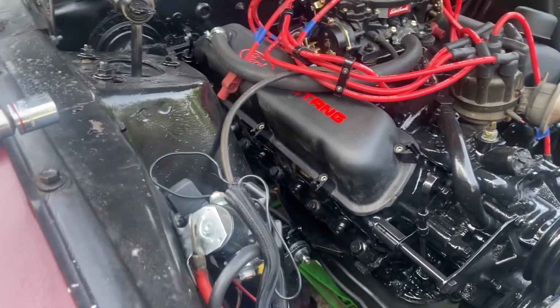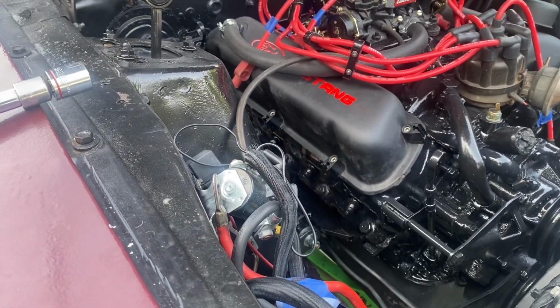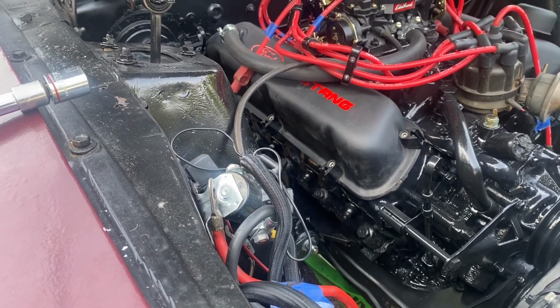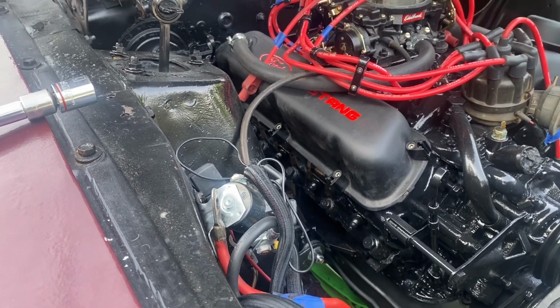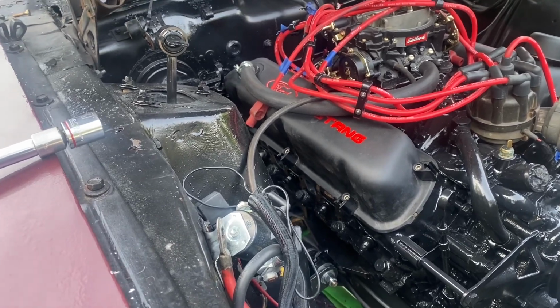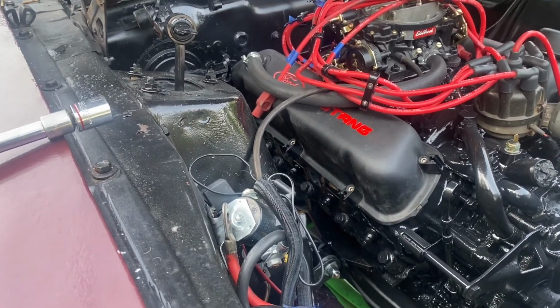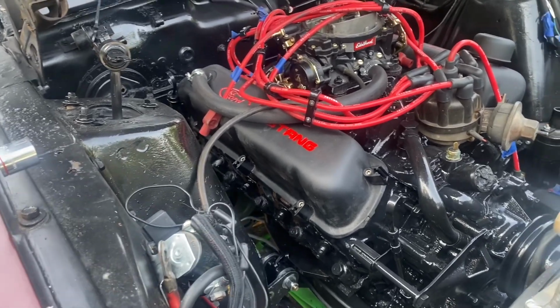If you do use the TCP motor mounts, I can tell you that the short flange goes towards the front of the car. Otherwise, your transmission mount will be off. And I know you could probably make up for that other ways, but I'm using stock style stuff, so that's how I knew it was wrong.